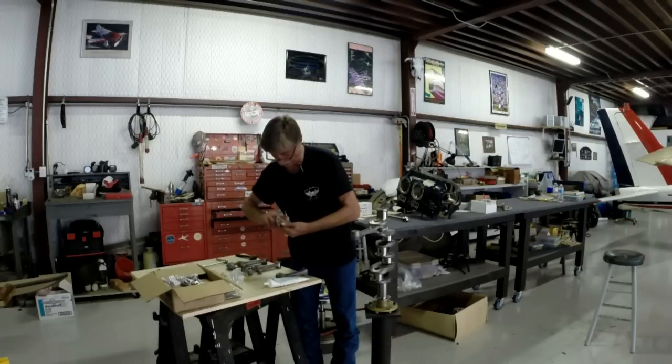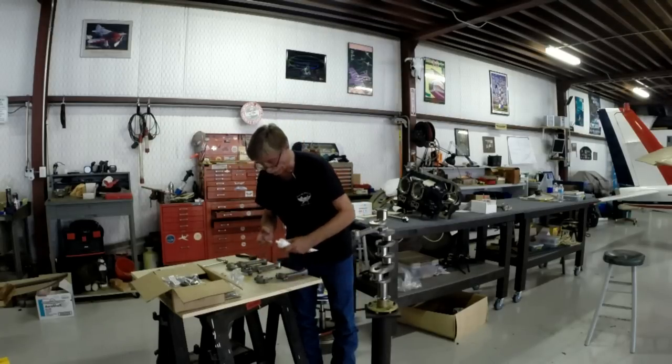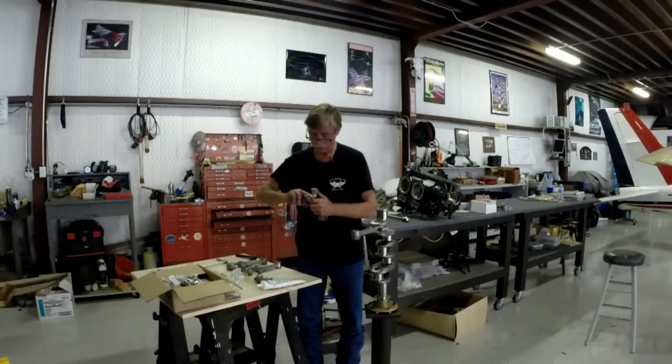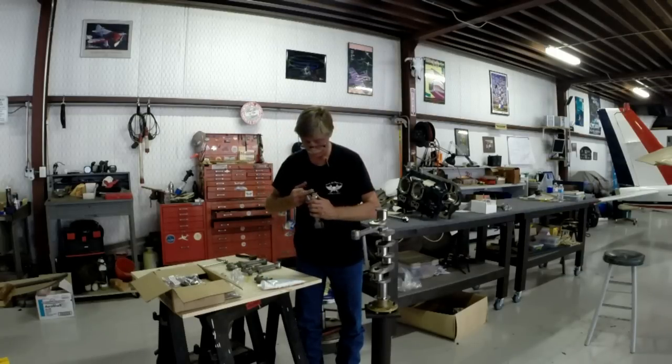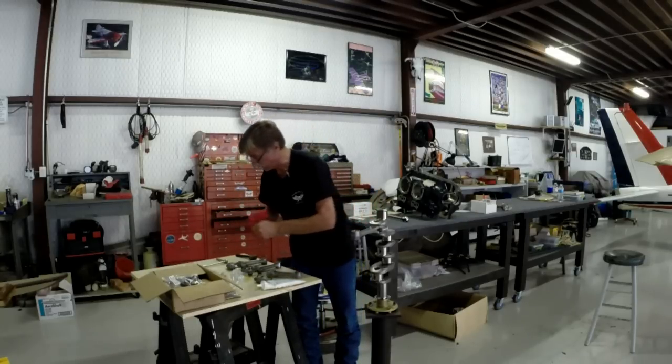Just a generous amount of lubrication. Again, like you said, you don't want these things to start up dry. The lubricant plate is designed for this and is soluble in engine oil, so it will dissolve and be completely gone in no time. But it ensures we get a good clean start on the engine.